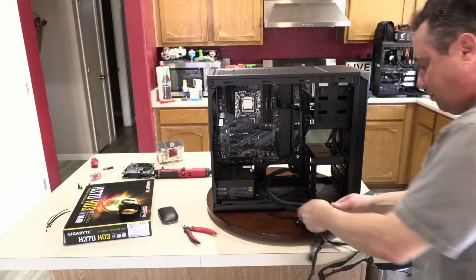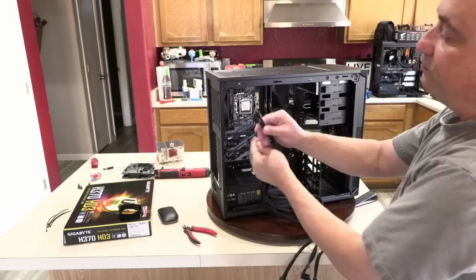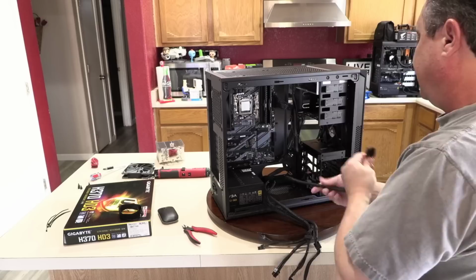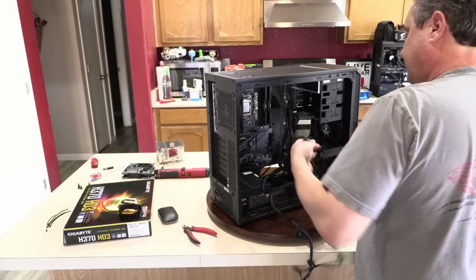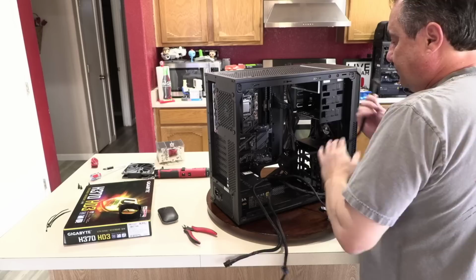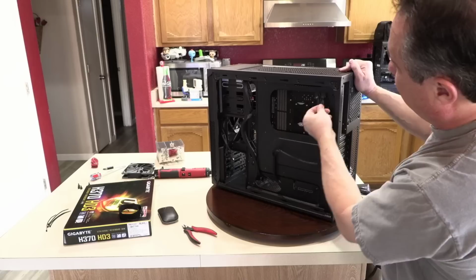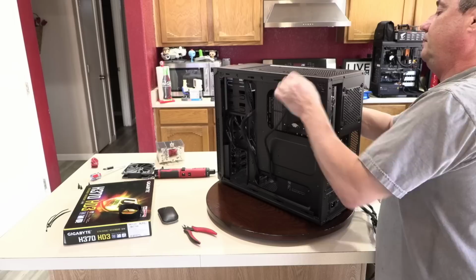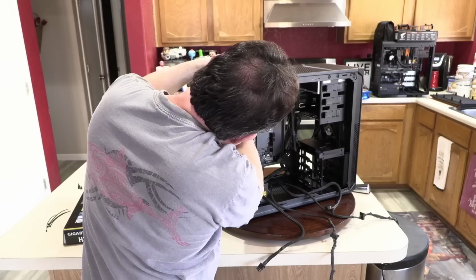And then in here somewhere I have, there it is, in this case, it's two 4-pins that we'll push together to make one 8-pin connector. And this is the time to untangle these cables. And we'll run that out right through here, the slack through and then up into this corner. And we'll pull that through here. And again, we have to push these two together with the clips facing the outside edge of the board. That's going to go right on there. And it's super easy without the heatsink in the way. Just clicks right on there.